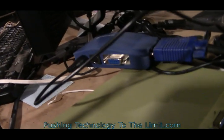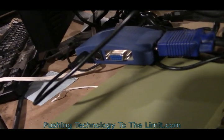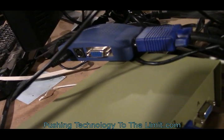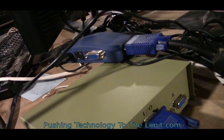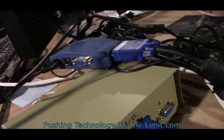through some hoops. So let me show you that piece of equipment I've got to make this work on my HD monitor. It's basically just a TV set, but I'm using it for my computer monitor. So I've got this VGA converter to S or RCA. Then from there I take it to an HDMI converter, which converts composite video to HDMI, which works, but it's a lot of hoops just to get your display on your HD TV or your monitor, whatever monitor you have.